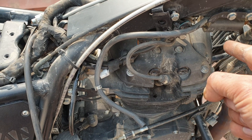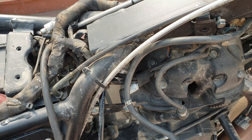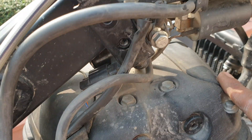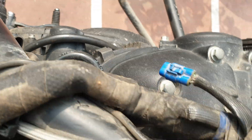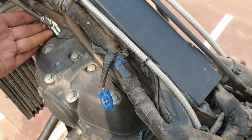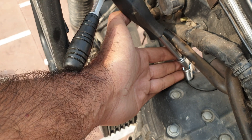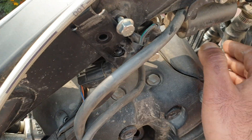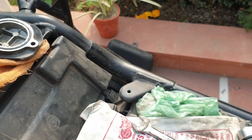Next up: opening the spark plug and the tappet covers. The plug is out. I have this bendable arm attached which makes it kind of easy, but it's still doable without it. There are two bolts — one on each side — same for intake. These are 8mm. I've opened three of them: both for the intake and one for the exhaust from this side. The bendable arm really comes in handy for the exhaust one on the left side. All the nuts are out — simply bring the covers out.